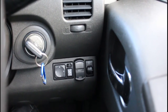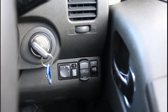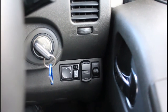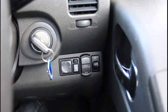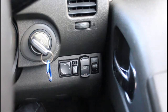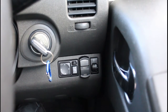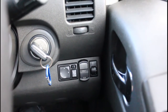There are a few things you can do to overcome that. On this particular vehicle — the Nissan Navara D40 — there is a way to disable the smart charging system, which just makes the alternator go back to a regular type of alternator and operate with the internal voltage regulator keeping it just over 14 volts most of the time. So we'll hop under the bonnet and I'll show you how you can do that.